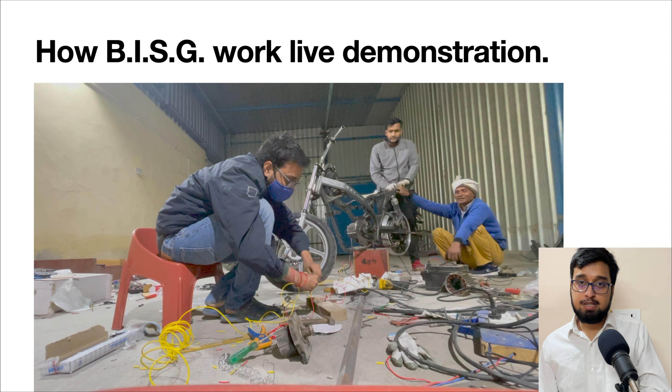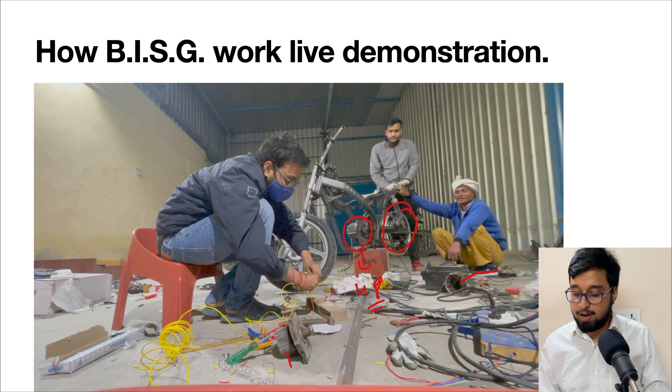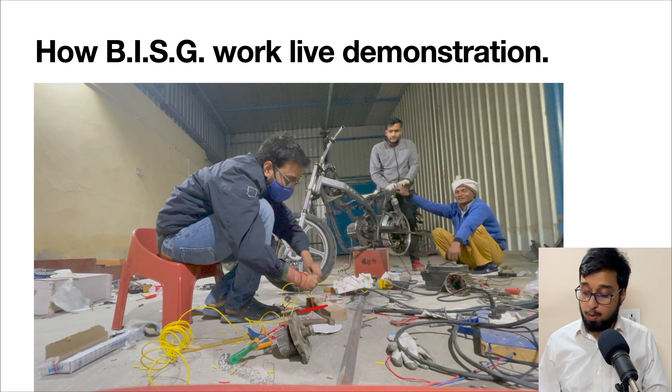To summarize how the ISG works: as a starter, power flows from the stator to the rotor so it can rotate and start your vehicle. During regeneration, the stator is magnetized and the rotor opposes it with forces from the crankshaft due to bidirectional flow — if the crankshaft rotates, the rotor rotates, and vice versa. Power flows from rotor to stator, the magnetic field collapses, and the sudden voltage drop generates electricity that charges your battery.